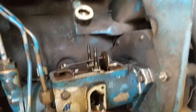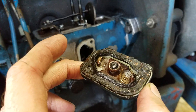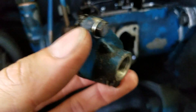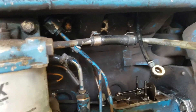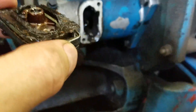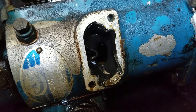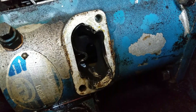Now interestingly, the gasket should be new, but it looks like it's in really bad shape actually. Unfortunately it's like a little cork gasket that goes in there. This is basically where there's a nut right here that comes from your filter, comes down into this cover, and has a little ball valve there to let the fuel only go one way. And then it's got this kind of rubber gasket that goes in over that.